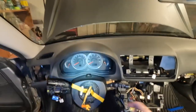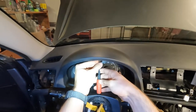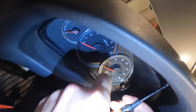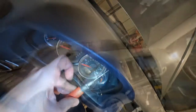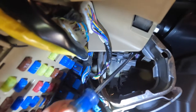Steering wheel is out. Next up is the dash cluster — very simple, one little Phillips. Have your wheel as low as you can because it is pretty tight getting in there. Get this top screw securing the cluster out. There are two holding the bottom — they're very hard to spot but they're in these black slots. I'll point to it: there's one screw, and another on the other side.